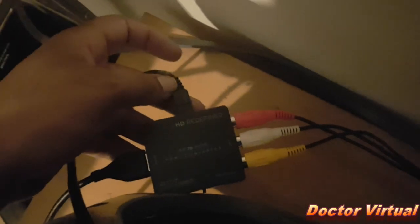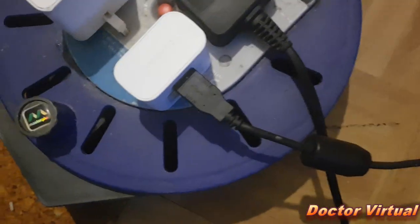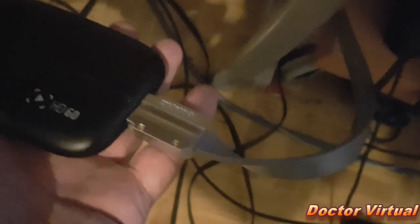I've got those, and I've got the AV to HDMI converter. I've plugged those in — that's connected to the PS3 all the way through. I've got a power socket to give the converter life. This cable is going all the way into my Elgato input port, which needs to be plugged into the PC via USB. And this one is going back into the TV. That's all I need.